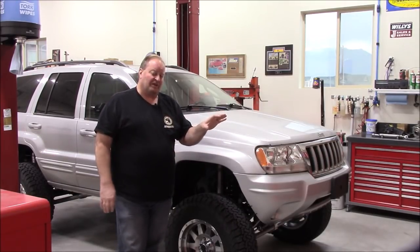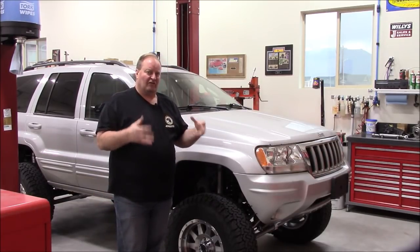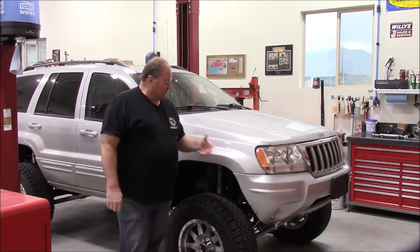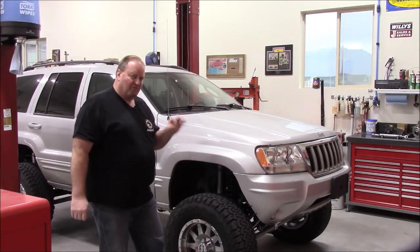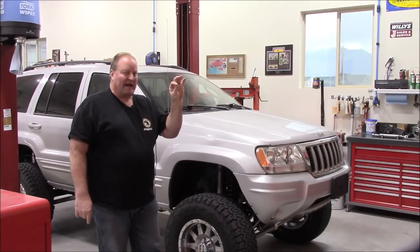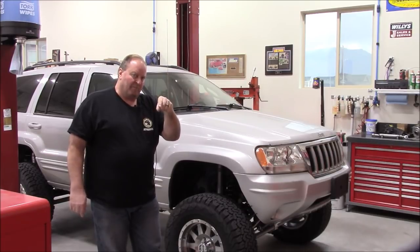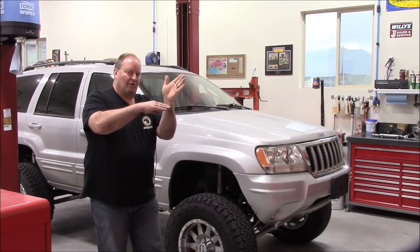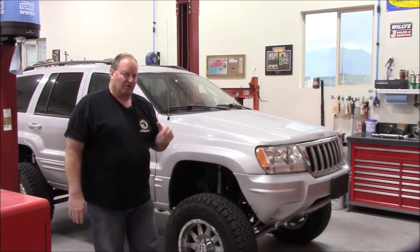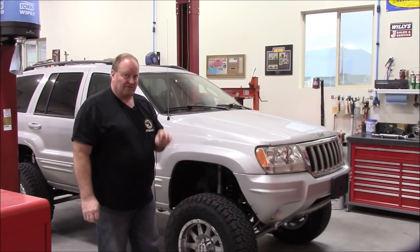We opted to leave the stabilizer off for about a hundred miles, double-checked everything, and then went ahead and put the steering stabilizer on. After we got the alignment done and fine-tuned everything, we go through and paint all the heads of the bolts and the bracket they're going through, so you can do a quick visual check — if you see a paint mark offset where the nut or bolt head is, you can tell something is backing off or coming loose. So we've gone through and painted everything up, and it's at the final adjustment.